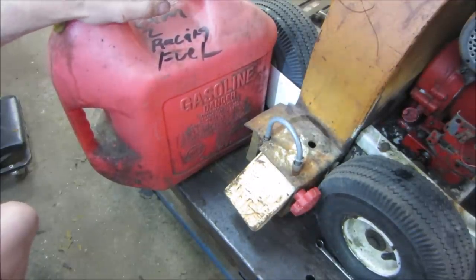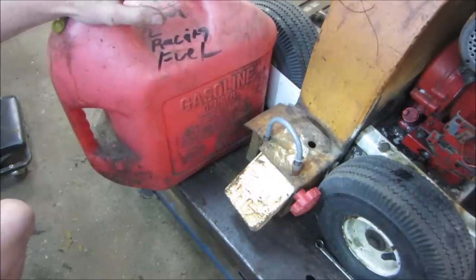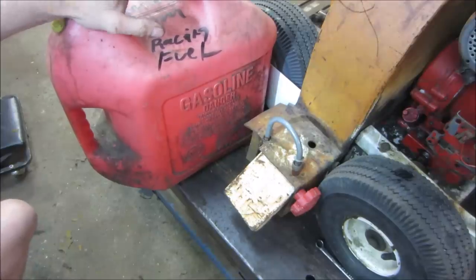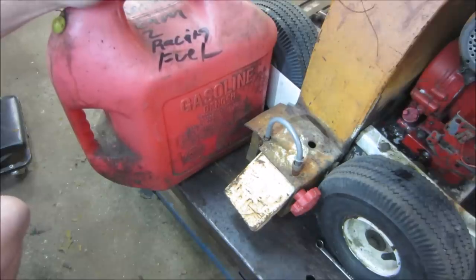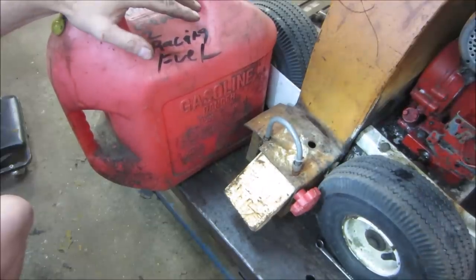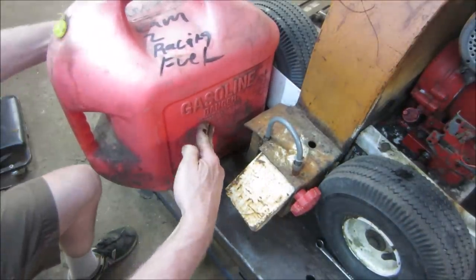But what I see more of in my area is, because there's such a big temperature difference between day and night and winter and summer, that things that are open to the atmosphere, like this blower right here, exchange air with the outside much more, and it takes the moisture out of the air, I find. That's where I see the water coming from. I find that if something is sealed, like this container, you actually can kind of see how it's puffed up.